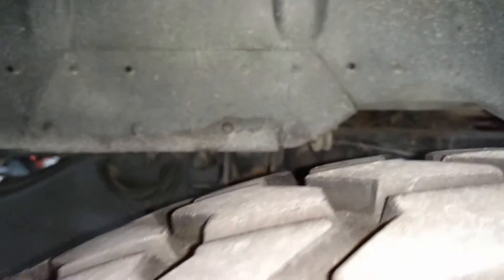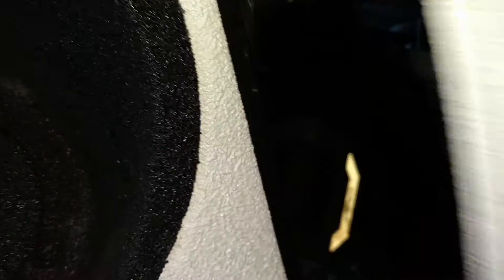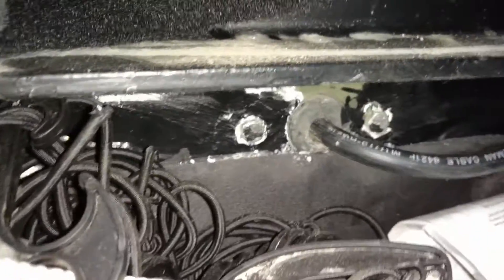Up underneath the body there, next to the frame, I put a little slack there where that cutout is for the suspension travel, and then came up and over top of the hose used to fill the fuel tank. You see that bulkhead grommet there — that's a military grommet that came with mine. If you have one, reuse them; they're excellent bulkhead grommets.